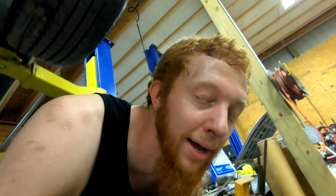But he has been hard at work on this thing, and the most interesting part about it, and frankly why it is back here in the first place, is he has changed cylinder heads and gone with a 420A head. So what that means is on an SRT4, typically the intake and exhaust side are backwards from like a B series Honda. So the exhaust is on the firewall side, the intake is on the bow side, or the foremost side of the engine bay. Now the 420 head, it flips that 180 degrees. Intake is on the firewall side, exhaust is on the bow side, and uses a different head flange. Everything is different with it, so his old setup was not going to work.